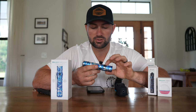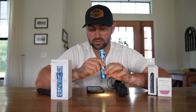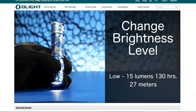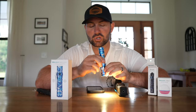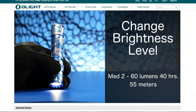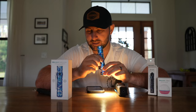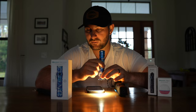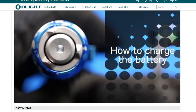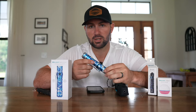For lower modes, we use the power button on the side. One click puts it in moon mode — 1 lumen with approximately 50 days of runtime. Hold down that power button for low mode — 15 lumens with approximately 130 hours runtime. Hold again for medium two mode — 60 lumens with approximately 40 hours runtime. Hold again for medium one mode — 250 lumens with approximately 10 hours runtime. Double press the side button for high mode — 750 lumens with approximately 160 minutes runtime. Like all of Olight's rechargeable models, the flashlight charges by placing the magnetic charger right on the tail and plugging into a wall outlet. If you want an extremely powerful everyday carry flashlight with cool ocean camouflage colors, check out the link in my description below.